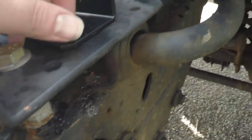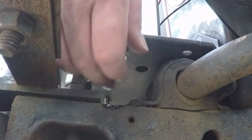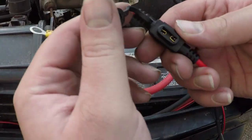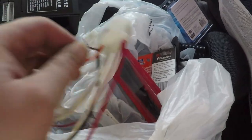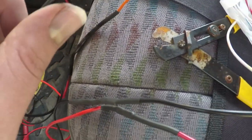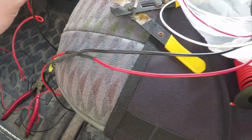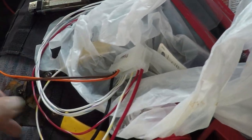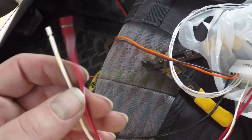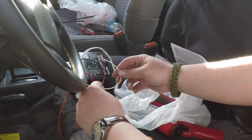Got those holes finally drilled all the way out. Now I'm going to get these bolts mounted in here — we're going to have a washer on there. Let's just hook everything up. There is no fuse in the wire yet — you want to wait until after to do that. I'm going to leave it like that for now and just test it to make sure it works. Here are the plugs and the wires — we used heat shrink tubing instead. The orange and brown are for the horn, and the red and black go to the battery. The last two go to the switch. We got the fuse in — let's tap these and see if it works. Sounds like it works!